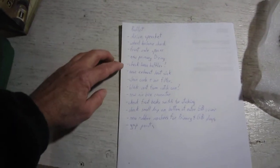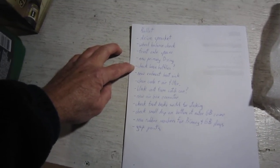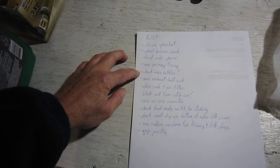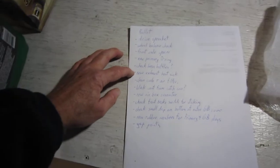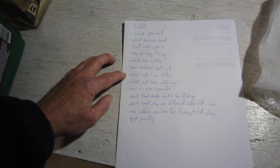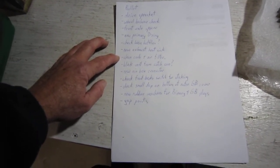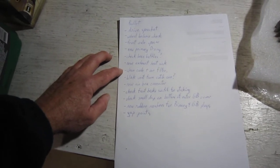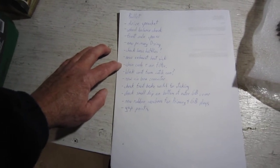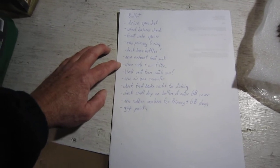The o-ring I've already covered. I noticed I've got a little bit of a rattling noise from the silencer, so I'm gonna check if I've got some loose baffles — I'll take the silencer off since I end up having to take off the exhaust anyway. The heat sink I've already mentioned. I've also got to take the carb off and clean it as well as the air filter. I haven't had the carburetor off since the late 90s, so it's time. It's not responding well — I think it's gotten some dirt or varnish in it even though I keep it drained between runs.